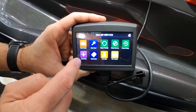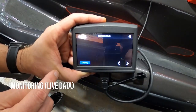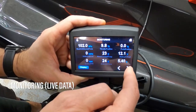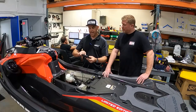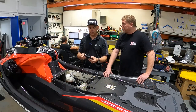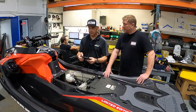Monitoring is a very, very powerful tool. It gives you full access to all of your sensors, including temperature sensors, ignition timing, air intake temperatures — you can scroll through these screens and see everything live. And you can actually monitor this while you're running the watercraft. You could stick the MapTuner up on a mount, be running on the water, and get all that live data as you're operating. It's great for finding faulty sensors and other items.